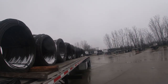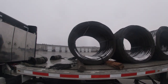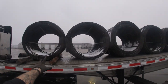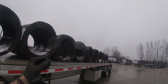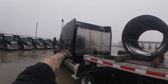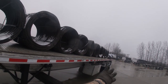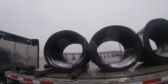Whenever I go to secure a load, I always start on the driver's side. As I talked about in a Tuesday dump video, it's all about setup and repetition — I already know how I'm going to attack this load. Starting from the front on the driver's side, I want more than half of this load pulling towards the back. You can never go backwards fast enough to throw the load off the back, but you can brake hard going forward and have it want to go forward — into you. So I pull the first six backwards and the last ones forward, and I alternate the straps.